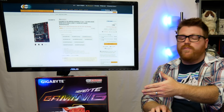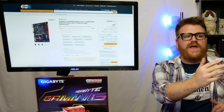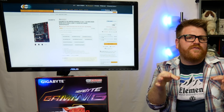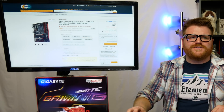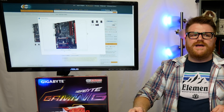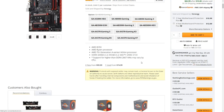This board is $119.99, the cheapest x370 on Newegg. I assumed it would have no frills but would overclock well and have good memory support — maybe no RGB, no dual M.2, limited PCIe slots, but solid fundamentals. What's frustrating is that for $20 less you can get the B350 version of this board that actually has more on it: RGB, more lighting, an extra metal shroud, and another full-size PCIe slot. And if you look closely, the x370 has the exact same VRM and power delivery as that cheaper B350 board.